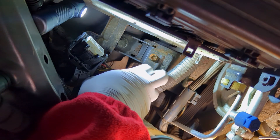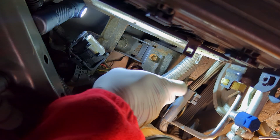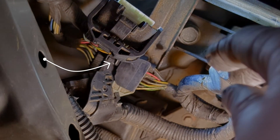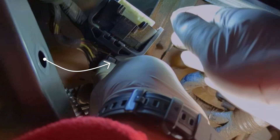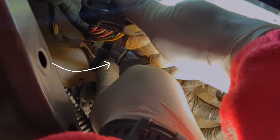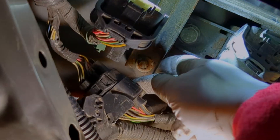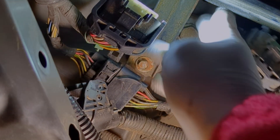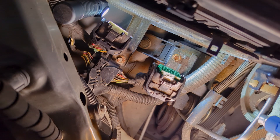This is the engine mount. It connects to the mount bracket right here, and that bracket is connected to the engine. You need to remove the PCM bracket in order to access the bolt, because it's getting in the way. Lift up the tab and then push it out. Now we can access this bolt to remove the bracket, and then after removing the bracket, we can access the mounting bolt. As always, this is a 10mm.